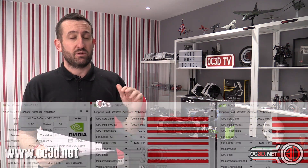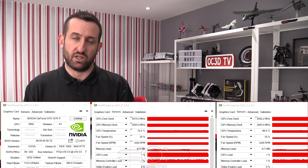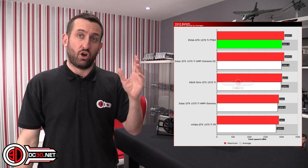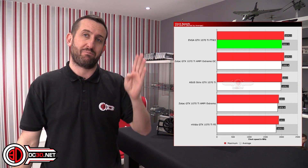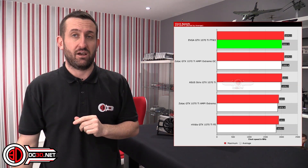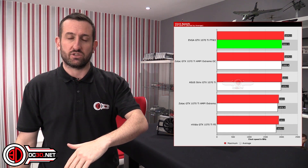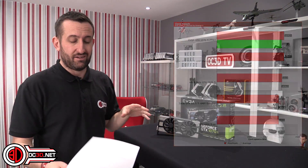With the EVGA we actually got a peak of 2075MHz, which is a massive score. I hear people talking about 2100MHz on 1080 Tis all the time, but the average is the one you want to look at. When overclocking these new Nvidia cards you have to run benchmarks each time, because you can hit 2100MHz but if you've gone too far the scores actually start to drop off quite quickly. Our 2075MHz was at the crest of the curve — we could get it to 2125MHz but the scores fell like a lead balloon, so 2075MHz was the right point to stop.